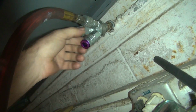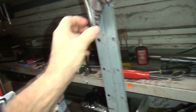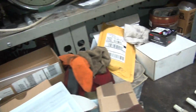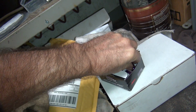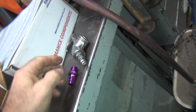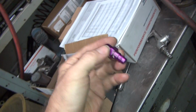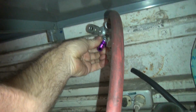So this is Milton. Heavy duty airflow here. These are regular ones up here. These are old ones down here. So there is your normal flow, and these are high flow. Workbench space sucks around here. There you go. Is there a difference in those two? Yeah, look at that, just slightly. It's double the size, so that's 4 times the flow. So when you put that in there, that'll empty out that air tank real fast.